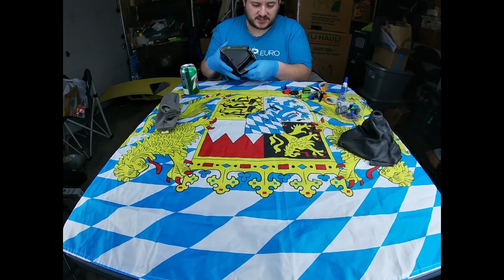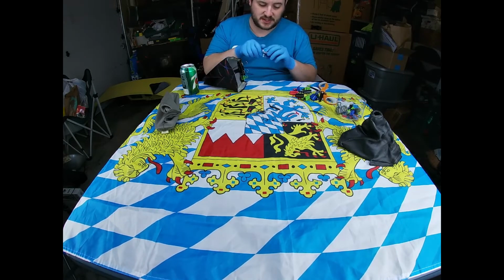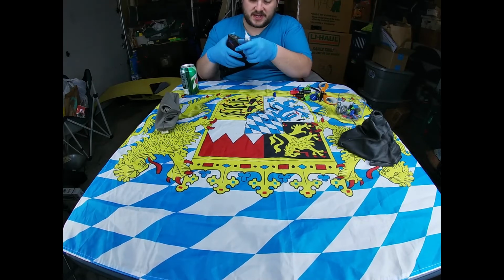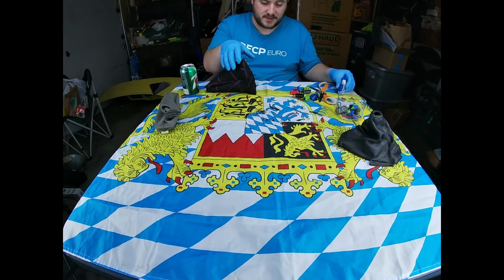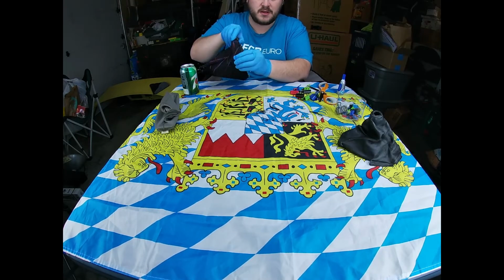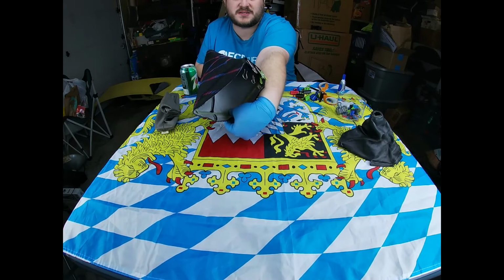So this is the part that gets people flustered, or is a bit more tricky. And this part you're actually going to use your hands. So this is where the gloves come in, so you don't get the glue on your fingers. On the outside radius of the frame, you're just going to get your glue in there. Don't get crazy with it, but put enough in there so it'll stick. Recap it. You're going to get your thumb, place it on the inside corner here, and use your 4 fingers to radius the corner like so, with your thumb on the inside like that.